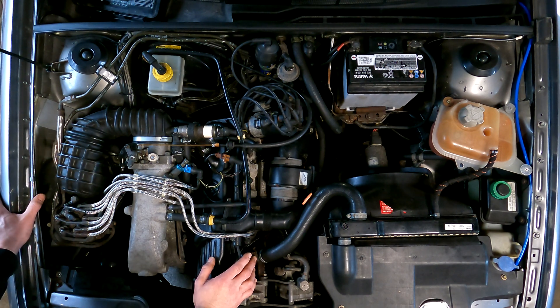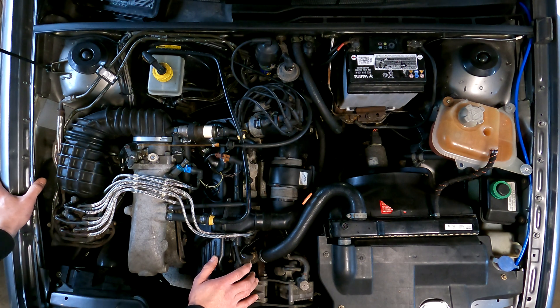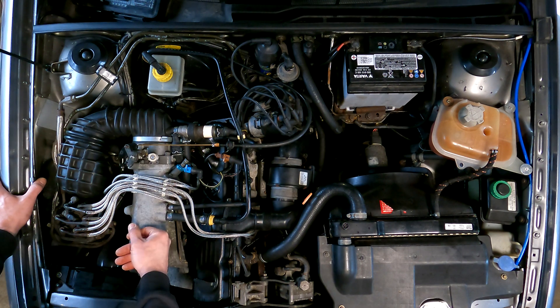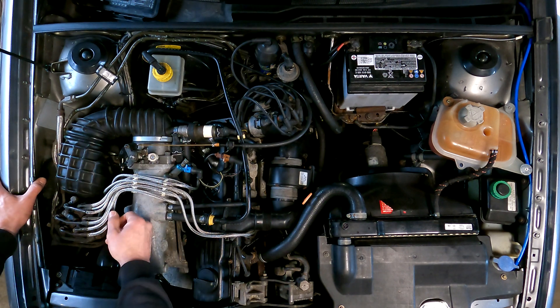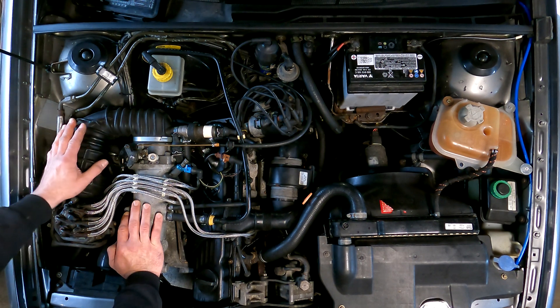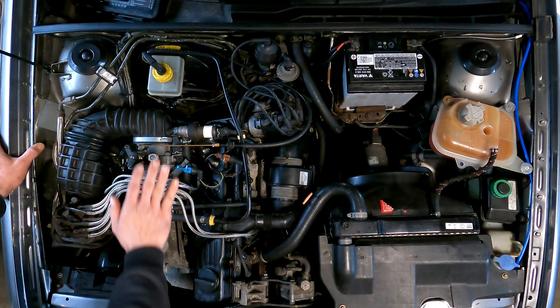The manual instruction says first, before you start any kind of adjustments, check that the car should be started with the pedal pressed a small amount - about half. Keep it pressed and start the key. The flap has to be open once your pedal is pressed. When the throttle body is closed, not much air goes in. The service book says once the engine is cold, keep the pedal pressed a small bit, and when it's hot, press it fully and keep it pressed constant until the engine starts.